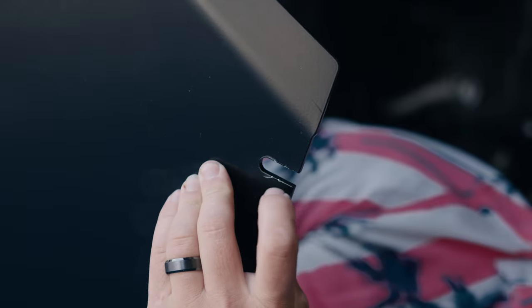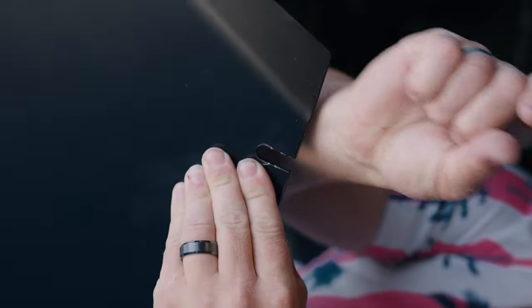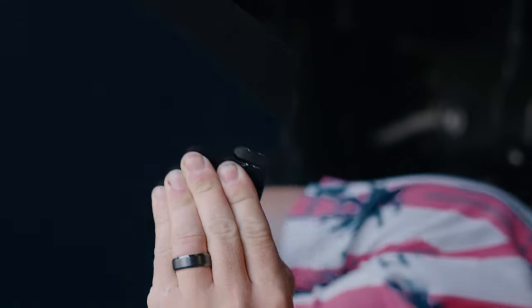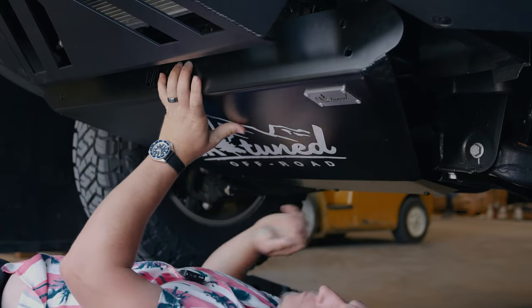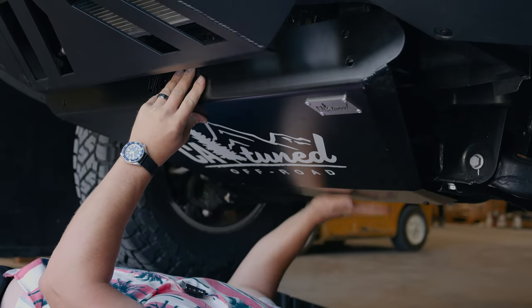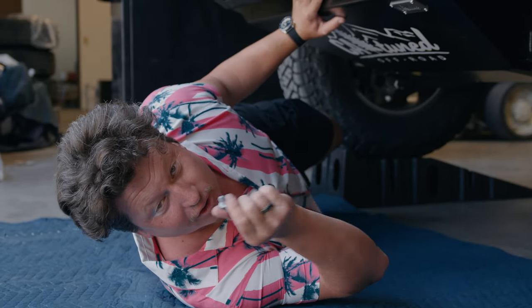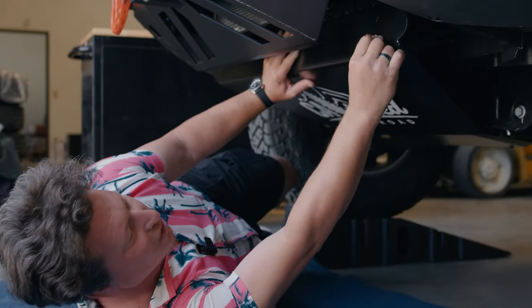You don't have to hold the whole skid plate. We'll show you here — you slide it in and you just lift the front of it. As you can see, this is open all the way through. You can slide them into the bolts that are hanging just a bit. That way it gives you, you don't have to hold them by your hands and all that. Bam — now it's holding on the two bolts. Then you use your factory four bolts, the 13 mils that you removed earlier, and put them back in the same position that you removed them.